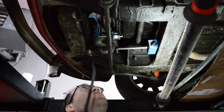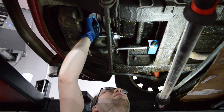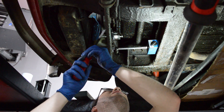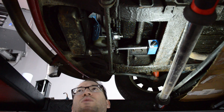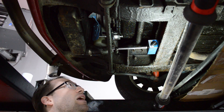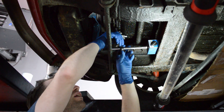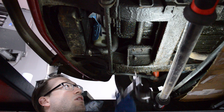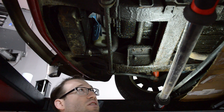I'm seeing about six thousandths of movement here — six, maybe a maximum of eight. The clearance listed in the shop manual is between four and eight thousandths. So since we're at eight, we're technically in the clear and we don't have to worry about the crankshaft end float being too far out. Although being at eight, that's going to be one of the first things we want to tighten up when this engine does come out for a rebuild.